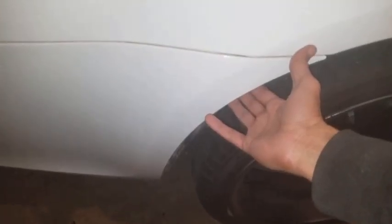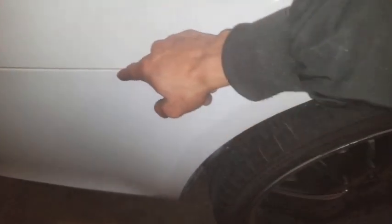See if we can get you. That one's broken. So there's a clip right in there that fits right into that. So you're just pulling off slowly to get those clips undone. We'll show you on the other side. The next step is to get these clips all down here removed. So you're gonna put your hand underneath here. There's a gap in there. You're gonna put your hand in that gap, and then you're just gonna pull slowly. See? Now I broke a clip. I heard it break. There we go. It's all off.